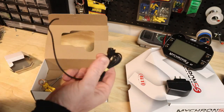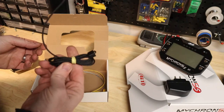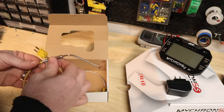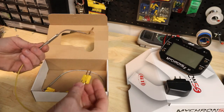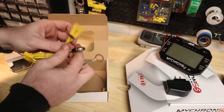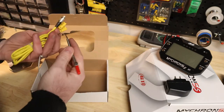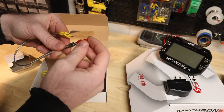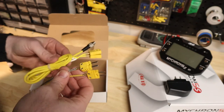Here is the tach wire — there's a clip for the spark plug wire. The other end routes through the back of the system and gives you your engine RPM readout. We also have the temperature leads. If you did not get a 2T model you'll get one of the options. This is cylinder head temperature — you have a copper ring to go under the spark plug, a heat-shielded cable, and a plug for the breakout cable which has two plugs. It plugs into the back of the Micron itself, and the two outlets go to cylinder head temperature, water jacket temperature, or exhaust gas temperature. Each connector is individual so you can remove the engine without unwiring the whole thing.